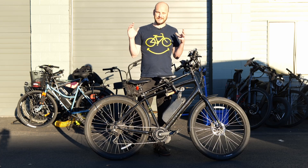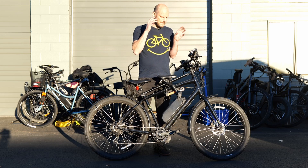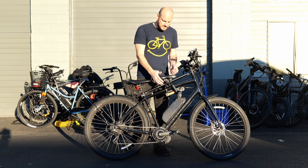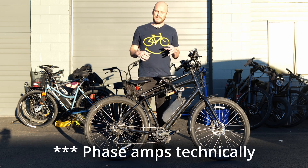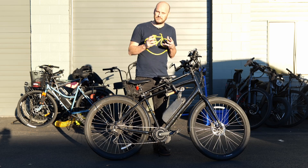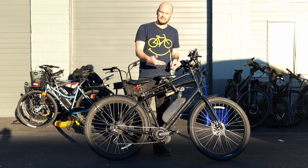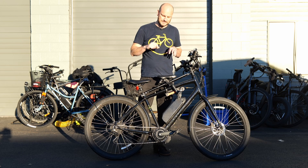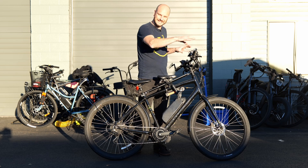The hill climb results were pretty much the exact same — I didn't notice a big difference. I made sure I was in race mode, max power, unrestricted mode — it peaked out at 2000 watts. So at 72 volts you're actually limiting your amps, and amps are what give you torque and power. The 52 volt probably had a slight edge on that hill climb because it's drawing more amperage. I wish I had something like Grin's ride logging to show amps drawn, but unfortunately the CYC Ride Control app doesn't support that logging.